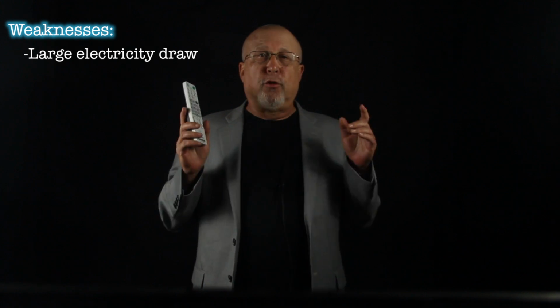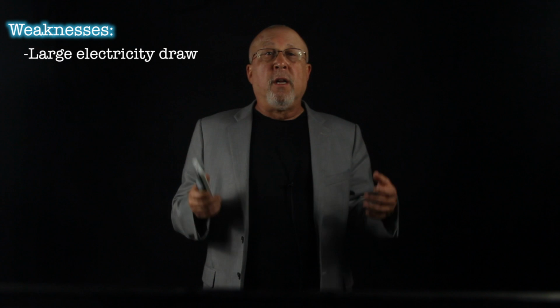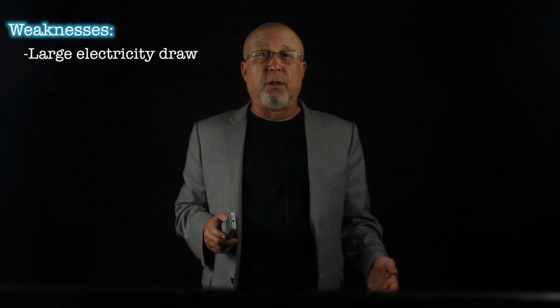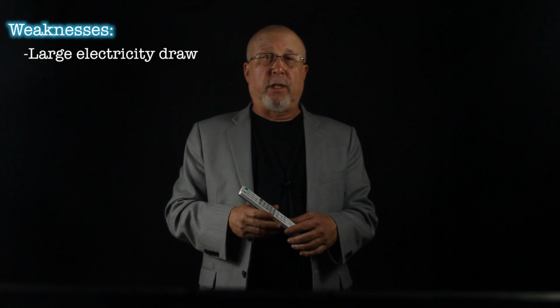That all sounds pretty good, although there is one weakness in its eco-credentials. This Sony projector needs more electricity. It draws more wattage than similar 3 LCD projectors using lamps. Consider there's a 6,000 lumen Epson we've recently reviewed that's lamp-based, pushes out 50% more lumens, more brightness, and yet only draws about 25% more electric.